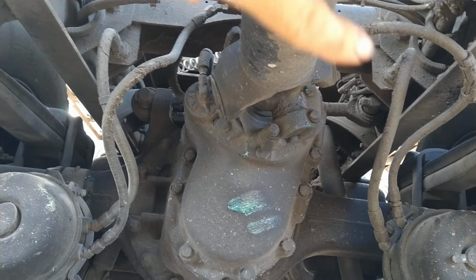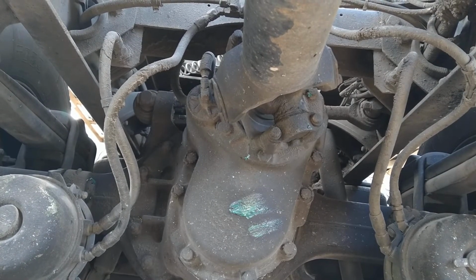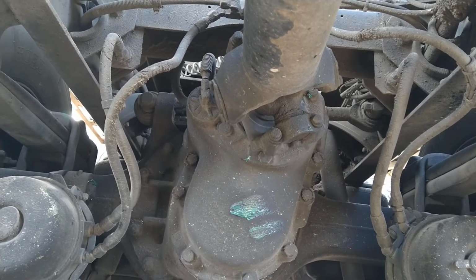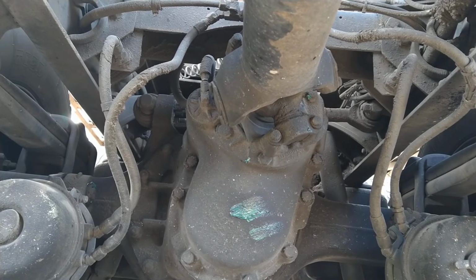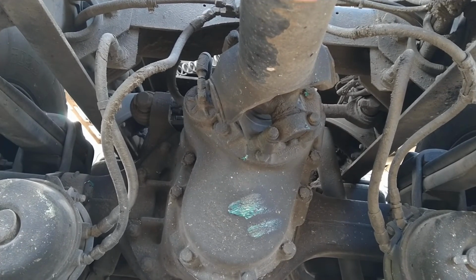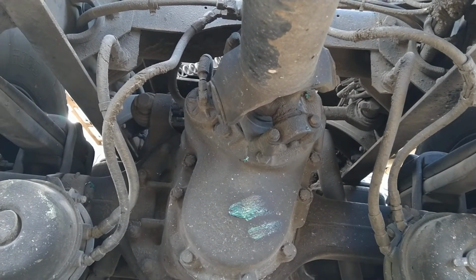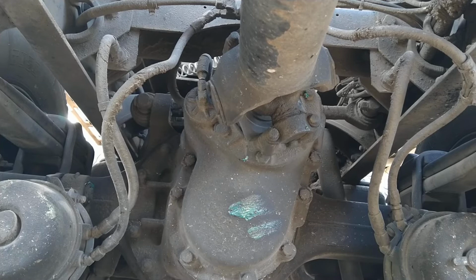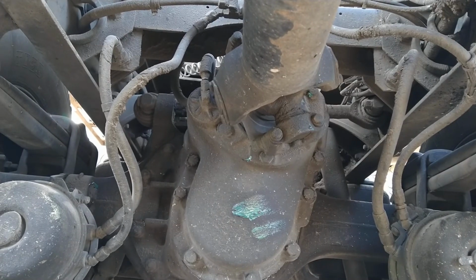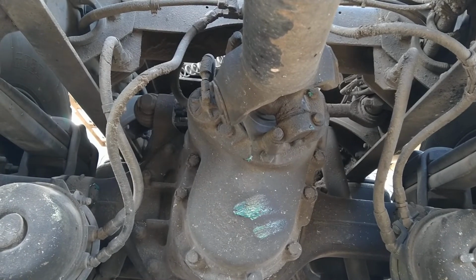So I held them up while the brakes were released. Then while the brakes were set and the rods extended. So then I had the brakes released again as they slowly drew the rods in by air power on a rubber diaphragm. Then I held the chambers up in the place they needed to be. They got popped into place. I got one nut on there.